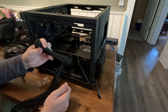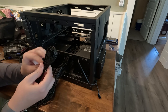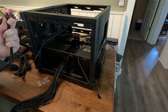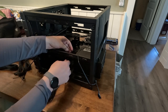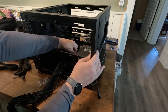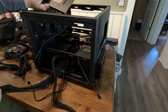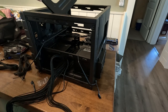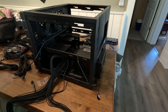This connector is going to power the CPU — you're always going to need it, every computer's got a CPU, especially building in larger form factors. It has a dedicated socket on the back of this power supply to connect into. Depending on where the 24-pin connector goes on the motherboard, I might need to redirect it and have it come out the other side of the case. Once I get the motherboard laid in position, I'll be able to make that judgment more effectively.